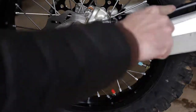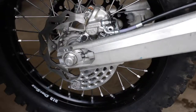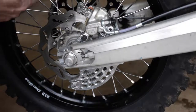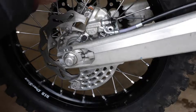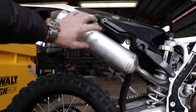I also switched over to the rear handbrake using all factory KTM parts with stainless steel braided lines, so everything is original equipment. I've also added the tubeless tire system. The tubeless tires are one of the most amazing things I've ever ridden. I'm running three and a half pounds of pressure and the traction is unbelievable — I was watching other guys paddle with their feet up a steep muddy hill running 15 pounds while I just crawled right up without spinning.